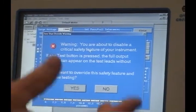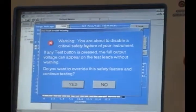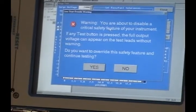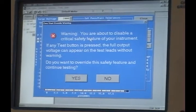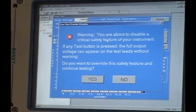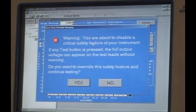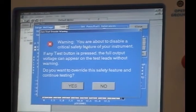So now whenever you press the button, it will automatically apply the voltage that you set your reference waveform at. So if you set it at 1500 volts, when you press lead 2, you're going to get 1500 volts applied to this winding right away. We selected 2000 volts because you typically want to go to 500 volts per bar.